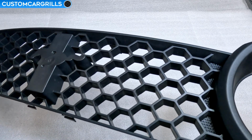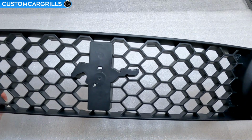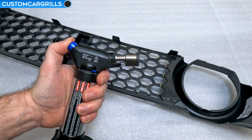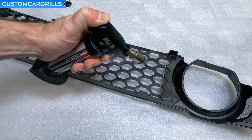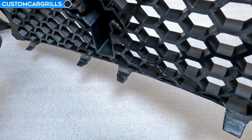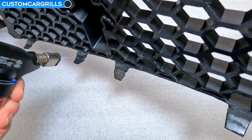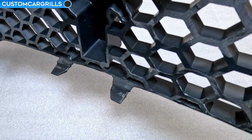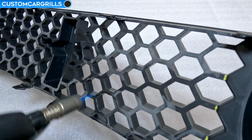There's just the smallest of fuzz left and a pinch of light discoloration in some areas. An easy trick to fix both of these is to use a small butane torch. Some quick passes on the back can zap out the fuzzies in no time. Restoring the discoloration can take a little bit more finesse. We want the plastic to get hot enough to darken up and gloss out again if possible, but you can't get it so hot that you actually melt or deform it. There's kind of a fine balance with this technique, and you're best off practicing on some scraps beforehand.